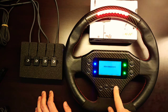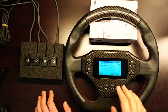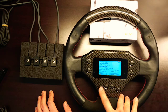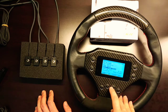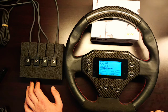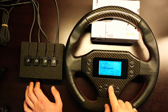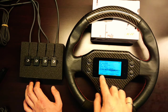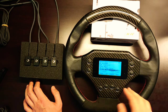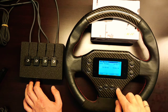You can set up several pages directly on the device. The RPM and lap time page can be enabled here, and this can also be done in Race Studio 2 software. The recall page can be configured to show a lap and RPM screen, lap and speed screen, or lap histogram. After passing a GPS lap beacon or IR beacon, the lap time is shown for a pre-determined duration — currently eight seconds — and you can auto-hide or permanently show the menu items at the bottom of the screen. Date, time, and time zone format are also configurable here.